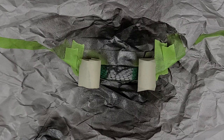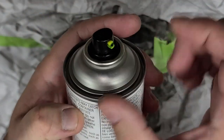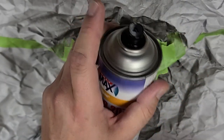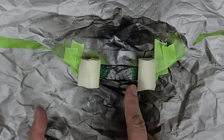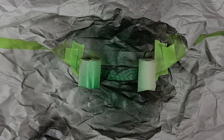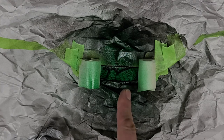I still have to use the rolled-up tape so I have something to feather sand. I need to turn this nozzle back when I'm done with it. What I mean by turning the nozzle: these cans have a fan spray. When it's set vertical, the pattern comes out this way when I hold the can. If I turn it back the other way, the spray comes out the opposite direction, and I don't want that because I don't want to get underneath the tape. So I'll go ahead and hit this with a few light coats.